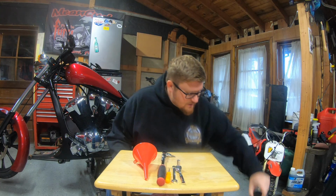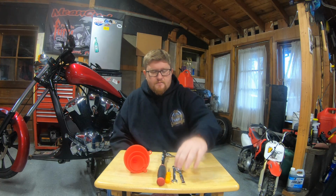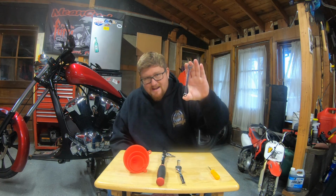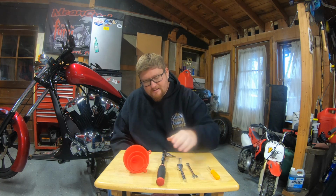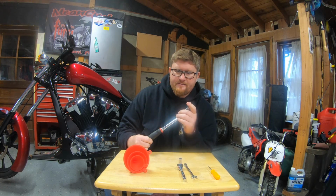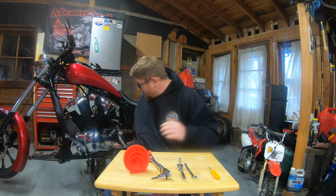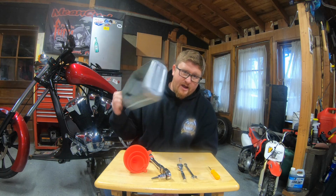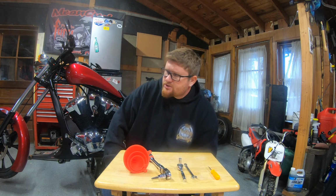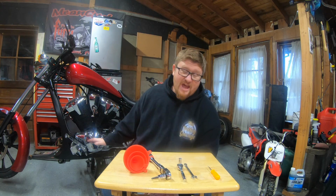Also, we're going to need some funnels. That's always good. We're going to need a pick. We're going to need a 10 and an 8 millimeter socket, and we're also going to need a number 5 millimeter hex head to complete the install. So that's all that we need. Oh, and obviously you're going to need a drain pan. I made this out of a 5-quart oil container, just because it's slimline and can get under. You can do this without a motorcycle stand.